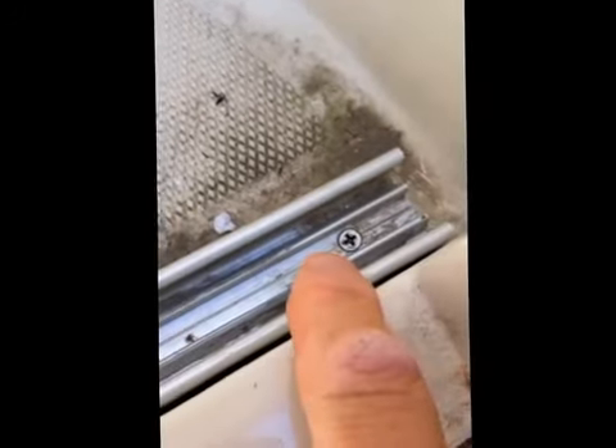Just very carefully, watching that top end again not to scratch the fiberglass, you can ease this in. With the track back in its place with a screw, which I'll put in — that locks one end of the track down so that we can start drilling. The screw is in, the door's runner can obviously move back and forth, so now we can drop the door onto the runner. You can see down in there the glint of the hole that I pre-drilled, which is going to take the bolt.